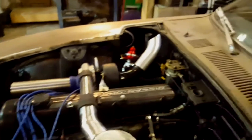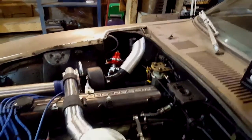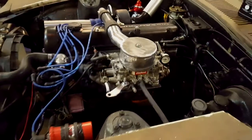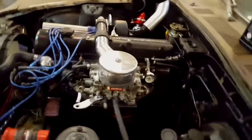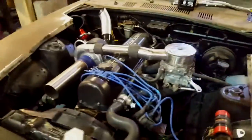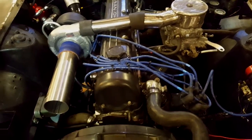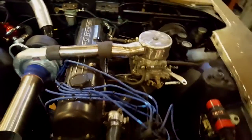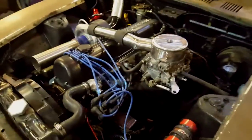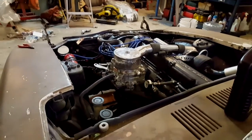I still need a couple of clamps here and there before throwing boost through it. The exhaust is kind of pointing up right now just so I don't burn a hole in the firewall. When we first fired it up it was shooting fireballs out of the carburetor, but I think we've got it dialed in now. I haven't actually forced boost through it yet so I don't know what it's going to do, but I can fire it up quick so you can hear it — it's not sealed right now so no boost, but it sounds pretty good.